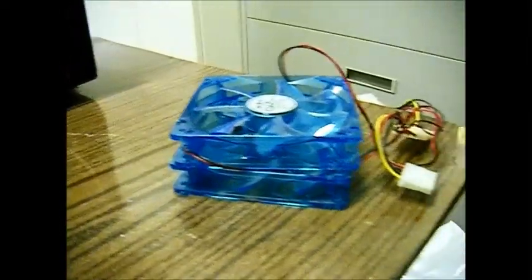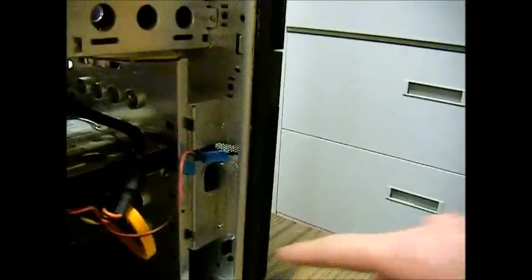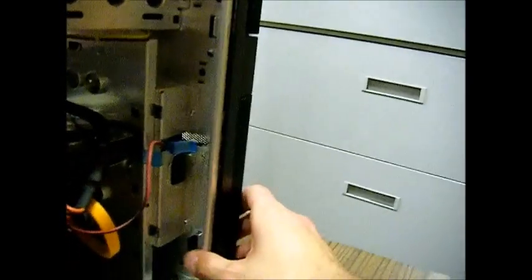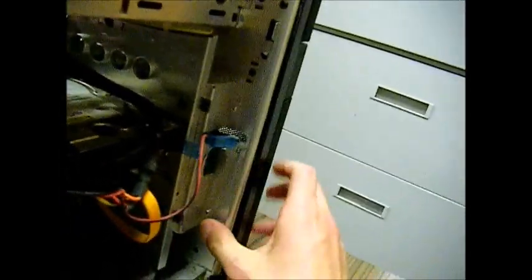We got the back fans out, and now there's one more fan right here in the front. Even if you don't have a fan in the front, you're going to want to take off this front panel because I guarantee there's a lot of dust piled up behind there. How you do that is very simple — you have a few clips on the side, one up here, one right here, one right here. There you just easily push. These things are pretty sturdy; they shouldn't break on you.